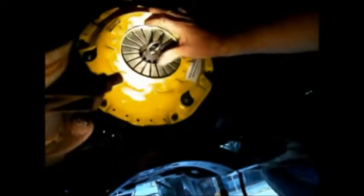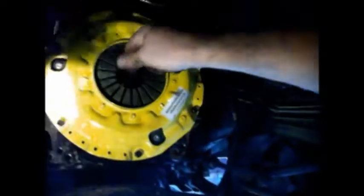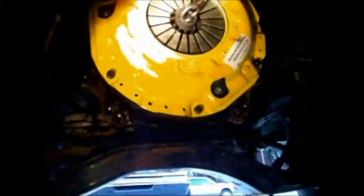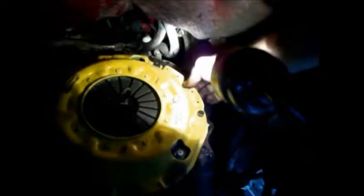That's our clutch. Our clutch is in place. Our alignment tool is close enough. That gets us kind of close to center. I guess I could have done a little bit better job than that, but we'll line it up with the shaft. It's going to move some. Look at this, guys. Good and tight. Let me check the little nubs that are left over from the pins that should have been in there, the alignment pins. I don't like that very much.